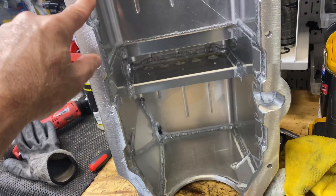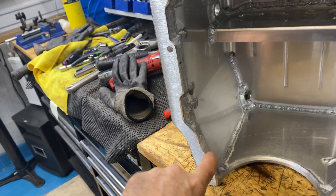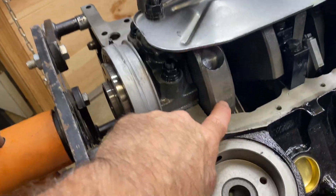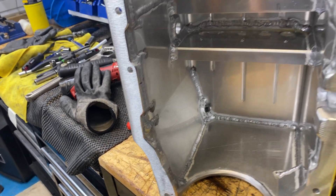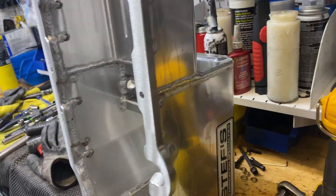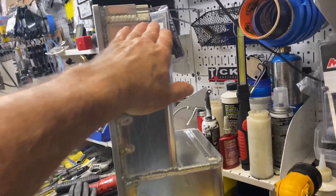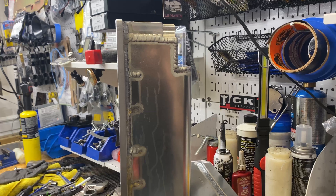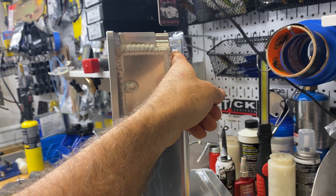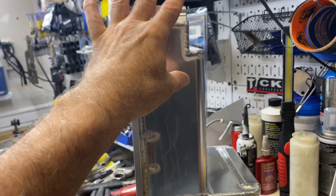The third reason is that the stroker notches always clears. The only place I ever have to clear is this area right here, because an aftermarket crankshaft usually has a counterweight that comes way out to the edge. Just this little spot right here I have to clear. Other than that, the thing will fit perfectly. It clears the chassis for Impala SS cars. For F-bodies, if you have aftermarket steering rack, it will most likely just barely touch, so you'll need to modify a little bit — put shims in. Stock, it will clear.